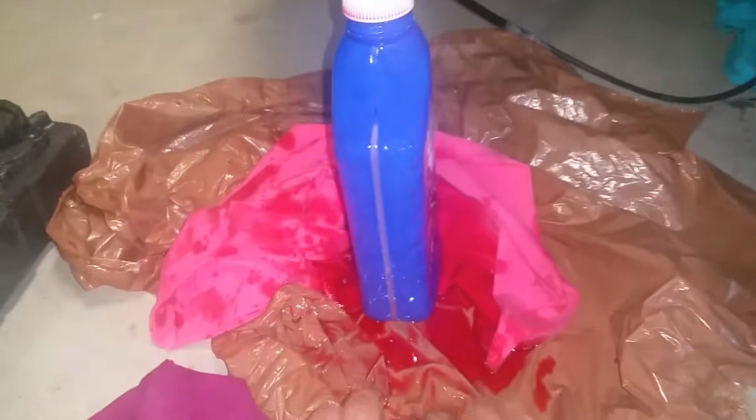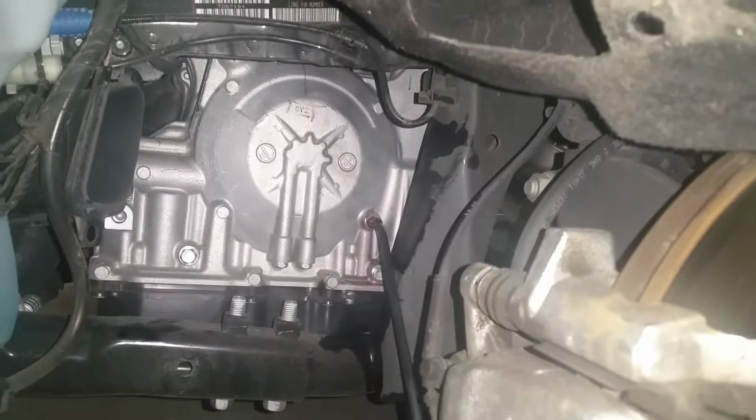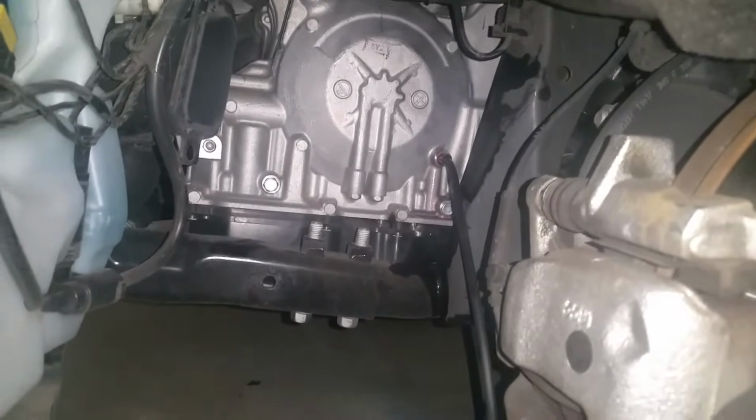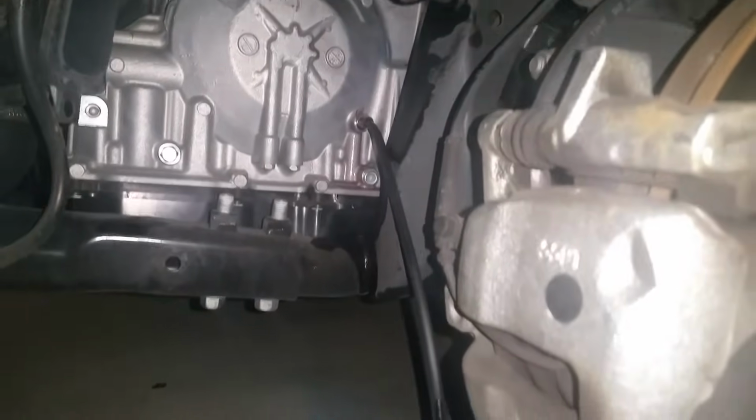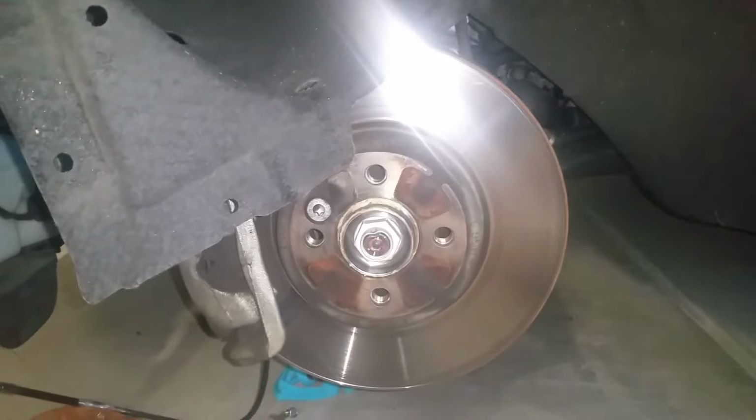This pump does leak, so I've got a little bit of a mess here, but you know what? I got that stuff back in there. I'm going to pull my landscape tubing, jam this 12mm bolt back in, tighten it up snug tight, clean up the chassis where I've got some drips, and replace this wheel shroud in the wheel well, which is pretty easy to do. They just take Phillips and twist right out. Didn't break any. Then I put the wheel back on, put my wheel lock back on there, and I'll be out of here.